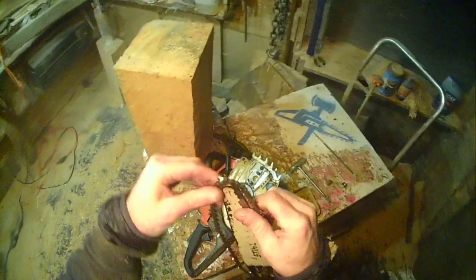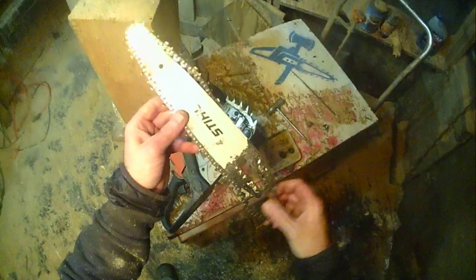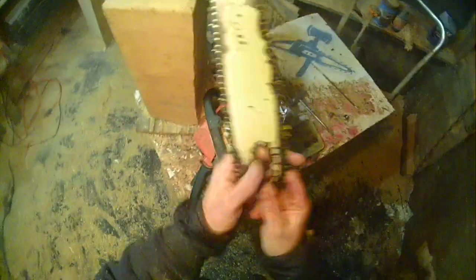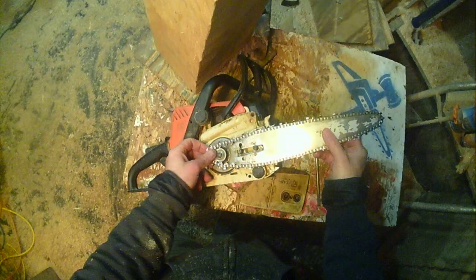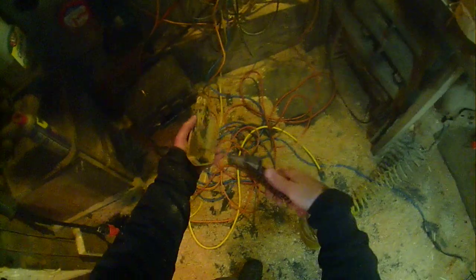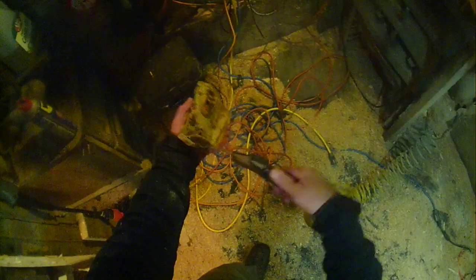That's how quick any grinder works, even the more heavy duty professional ones. I would highly recommend learning how to use the grinder, learning which part. You see, I drilled my bars out, so I'm choosing where the best oil flow is going to come out. I drill them and cut them. But as far as using that grinder, I really highly recommend learning the physics of how that grinder is going to benefit you or how it may hinder you by being too aggressive. The grinder can definitely be too aggressive, and what happens is the grinder's cutting on that chain.